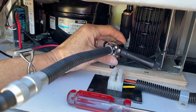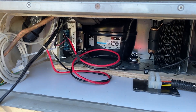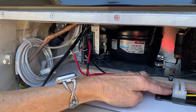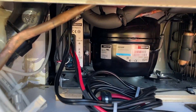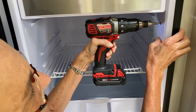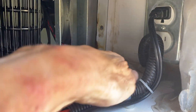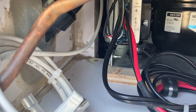I added a piece of three-quarter inch plywood for the back of the refrigerator to sit on and zip-tied the wiring up. We slid the new fridge in, connected the neutral wire first, then the power wires. It started up nice and clean and quiet. I then put the four screws back into the cabinet to hold the refrigerator in place. We had a little bit of aluminum tape to seal up the top, but we'll need to get some more.